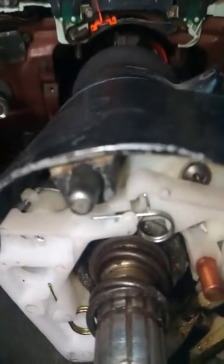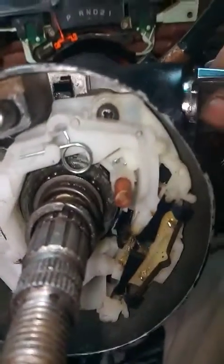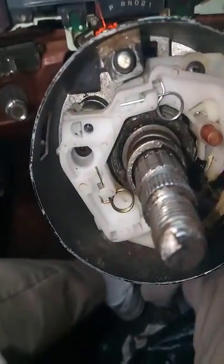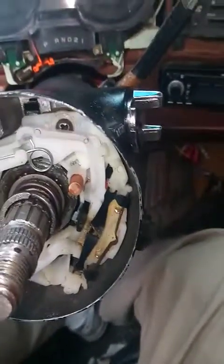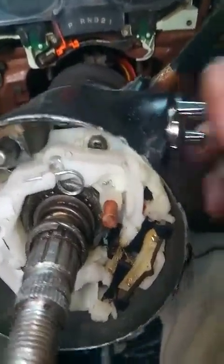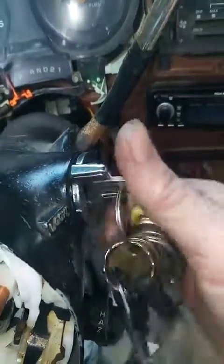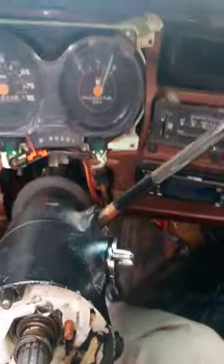It turned out there's a rack that the key drives, and it was off a tooth. Once I reoriented everything — I don't know how it got that way — but that's another thing you have to fix sometimes. I noticed this problem when I had the steering column apart once before for the turn signal switch. I'm just pleased now that it's operational. It locks properly and I didn't have that happening in the off-lock position before, but now I do. Thanks for watching, shalom.